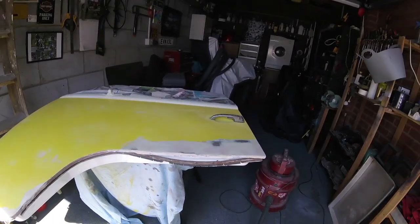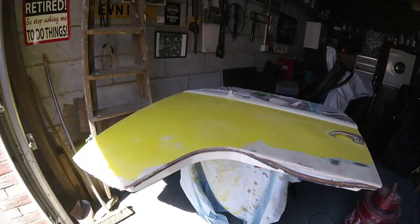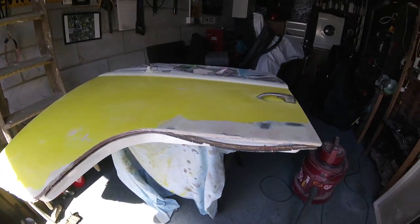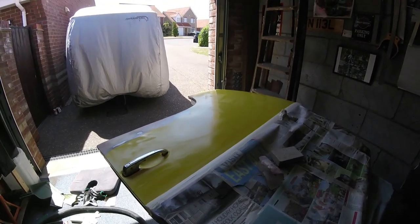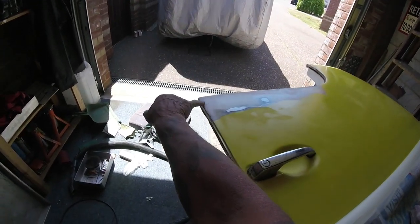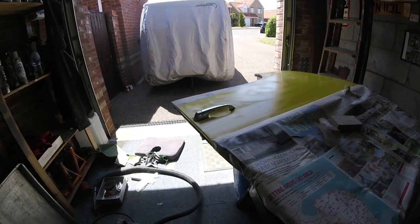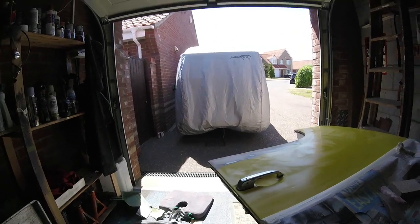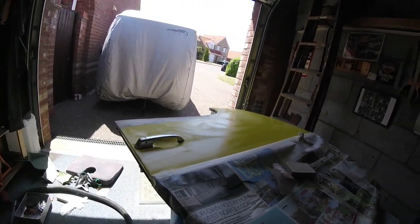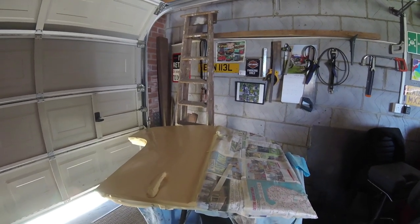I know I can't do anything tomorrow, Wednesday, or maybe only an hour, because I want the paint to dry a bit so I can get the door back on to get away on Friday. I need to get a move on. I'll just give it a wipe over with some thinners on a rag. What I've just noticed here - it's definitely going to need a bit more filler, maybe here too. I don't know whether to give it some undercoat and see what happens, or should I just quickly give that area another fill and rub. Decisions! I'll just give that a blow over with the undercoat - I'm going to keep well away from it now, not touch it, let that dry and we'll go from there. Just a quick glance from here - it's looking okay.